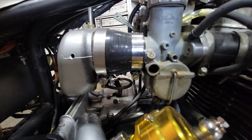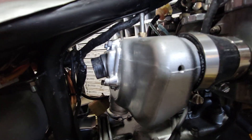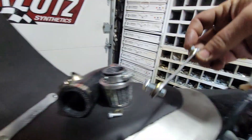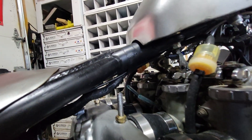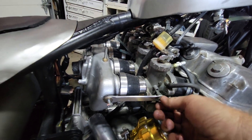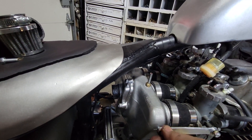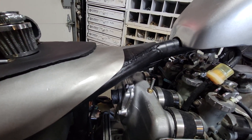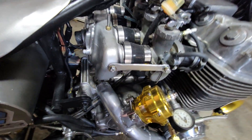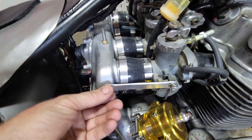You see these little holes here on the side — I was able to get some holes tapped in the throttle shafts here on the carburetor and over here on the charge tank. Made these little brackets; this little bracket will go in here, essentially bolt on once it all fits. In the past I've had a couple charge tanks blow off when you get boost too high, and when the charge tank blows off you've got a bunch of problems because everything goes wrong. Now what that does — the charge tank cannot pull off the carburetors, even if the boots let go. Everything stays in place.